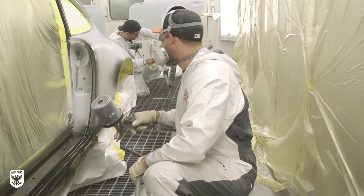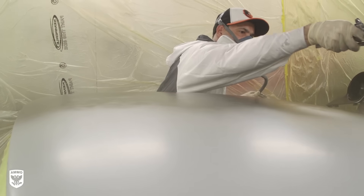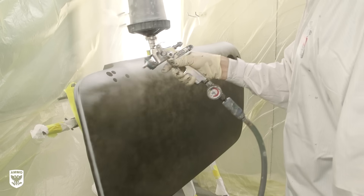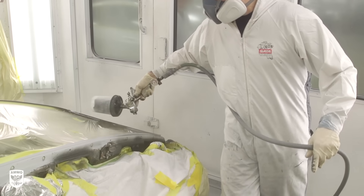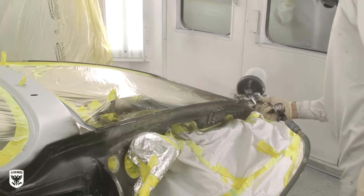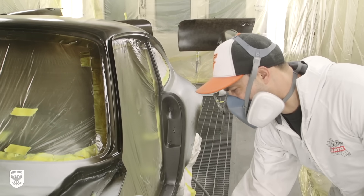This extra thought now will prevent de-nibbing later and result in an overall cleaner job. It's now time to add the first or base layer of paint. Notice how light or thin the first coat is — its purpose is to give the following layers better adhesion. If you go too fast and too heavy this early, you could potentially see runs in the paint. With the car almost completely disassembled, painting the frame, door jams, and tight areas becomes much easier and makes the repair undetectable, as no transitions or blending are needed.